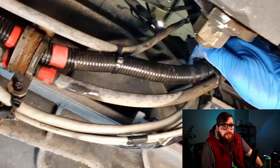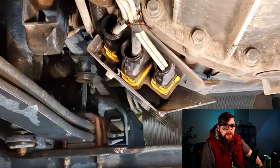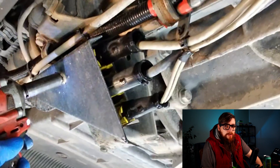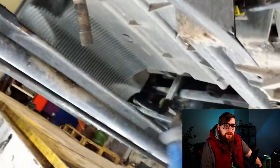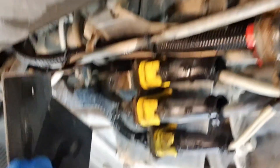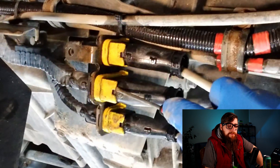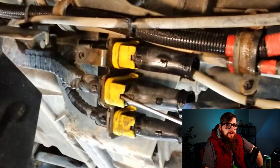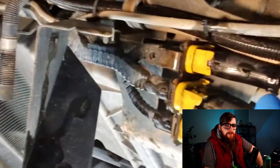With a trip down in the pit, I can go to the next plug along in the gearbox wiring harness and check what voltages we have here. If I follow the harness down from across the top of the gearbox and down the side, you'll see it comes up to this middle plug on the bell housing, which is covered by a metal protection cover. I can whizz this out of the way with my gun and access the plug. Let's hope this isn't full of corrosion — something I often see when technicians have had them open from clutch changes and not refitted them correctly, causing water ingress and me having to change the best part of 32 connectors.